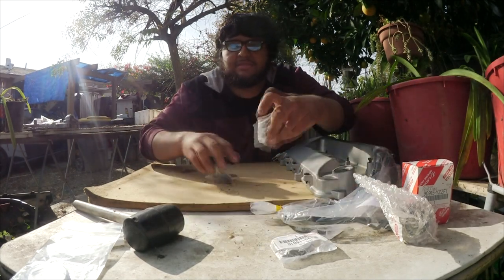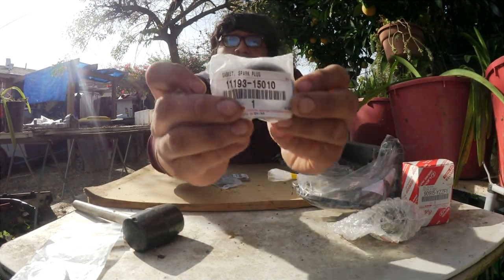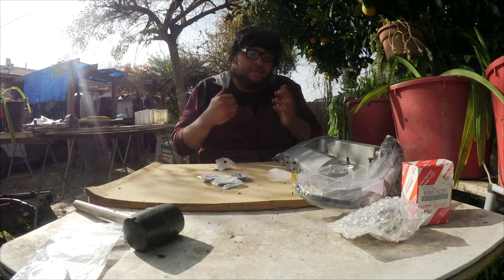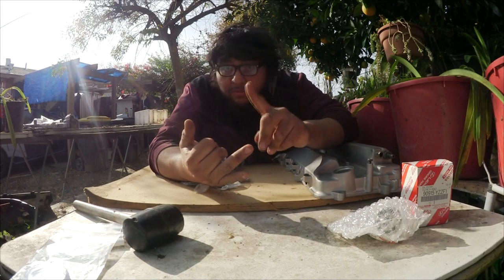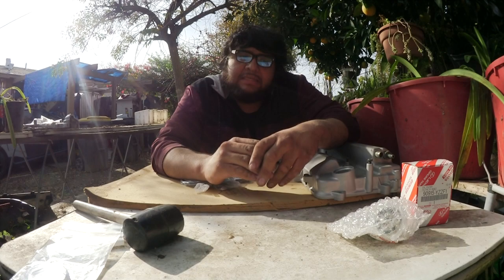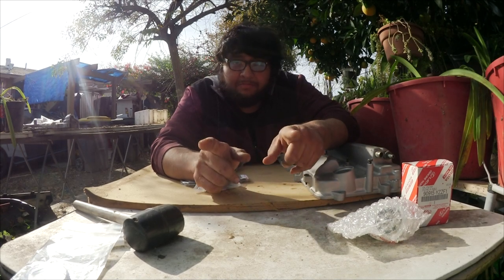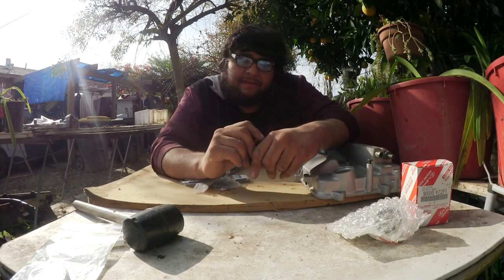Let's see. You need 4 of these for your valve cover. These are for your spark plug that goes right here. You really need to get OEM. I've installed Felpro, which is AutoZone and O'Reilly's, and they all have failed. Within 3 months, they started leaking. Maybe 6 months. They all leak. It's a true story. If I haven't uploaded the video yet, I will upload it in the future, but I definitely did make a video on Felpro gaskets, so stay tuned for that video.